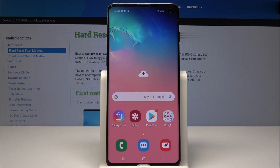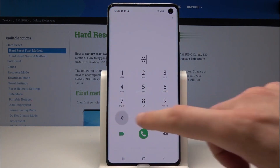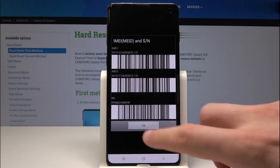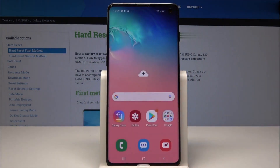To start, we're going to get the phone's IMEI number — that's a unique number for every phone. To get it, simply dial *#06#. As you will see, your 15-digit IMEI number will appear on the screen of your phone. This number is very important: it represents the ID of your phone, so keep it somewhere close because we're going to use it in a few seconds to unlock the phone.